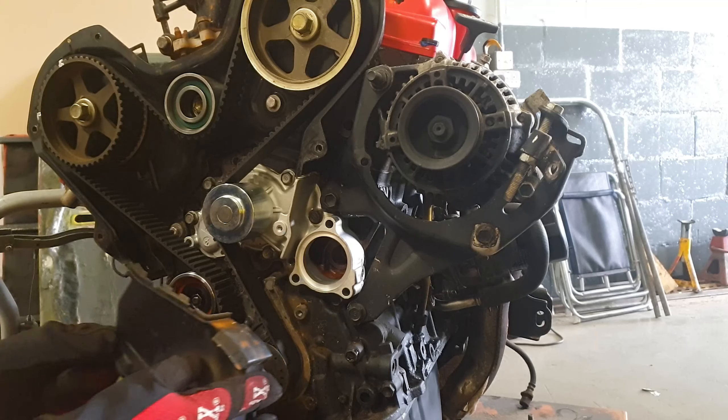So I'm going to scrape off the face, get the old pump back on, get the belt timed, and then we can look to put the engine back in. But before I do, I think the car's going to go up and we're going to get a look at a few other things, because it may be a blockage. We'll see you next time.